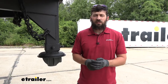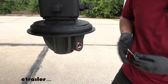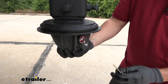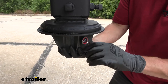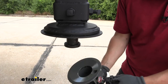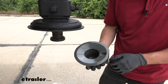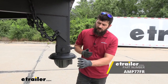Now we'll take our keys and put them in the vehicle or a safe place so we don't lose them. When we're ready to tow, we'll simply open up the little dust cap, reinsert our key, make sure you have a good hand on the coupler lock, and then rotate the keys. Pull the lock core out and then drop the lock down and out of position — now we're ready to tow. And that's going to do it today for our look and installation of the Amplock Kingpin Lock for fifth wheel trailers.